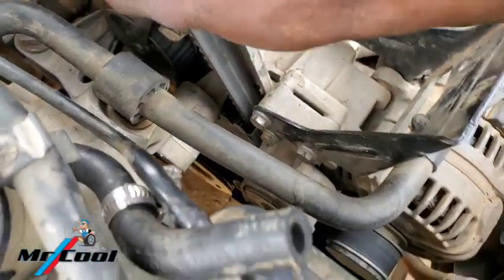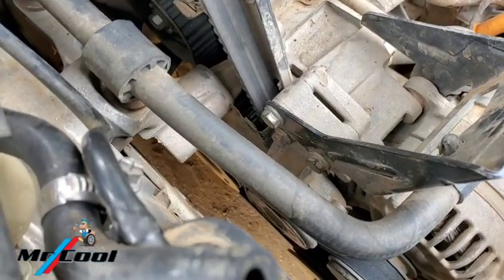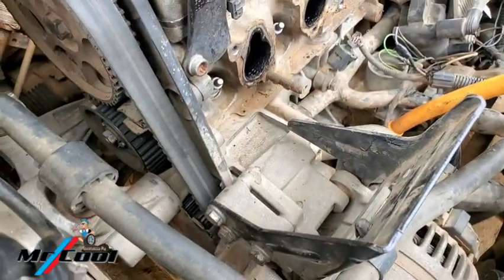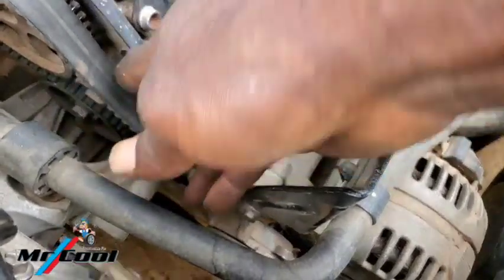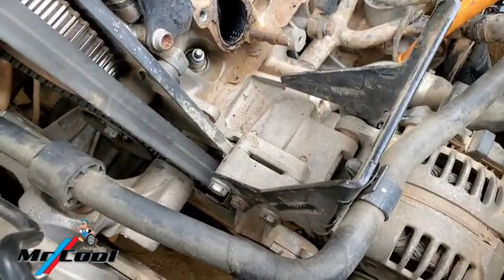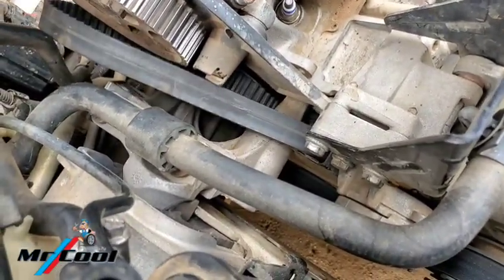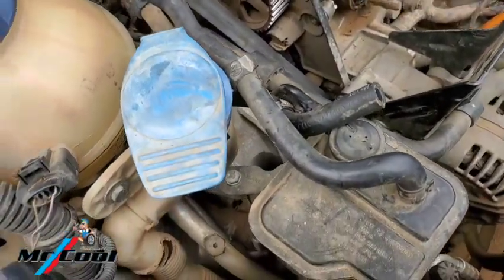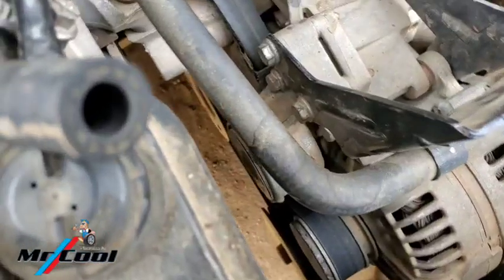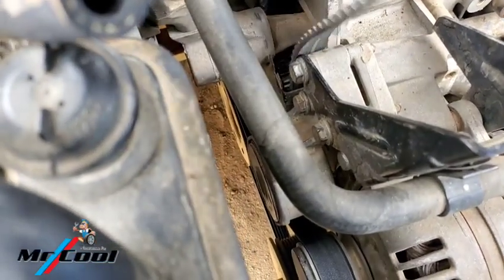When you're about to set the timing at last, so right now you can decide to just grab it here. You can see that. So it's now loosed. You can simply take the timing off. Some manufacturers can be crazy. They don't put this notch, and they will advise you to buy a sprocket stuff that's gonna hold it in place. So now that this one is here, there is a bolt you need to lose out here that holds this rubber in place, because this rubber most of the times does extend downward. So you wanna lose this rubber, and don't forget to put it back when you are done.